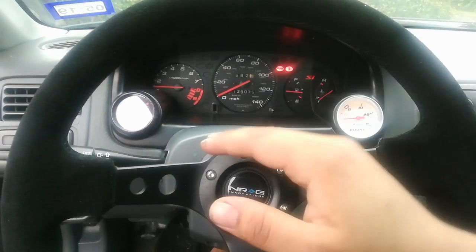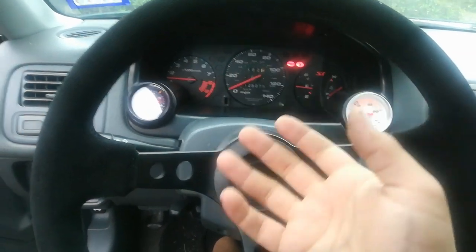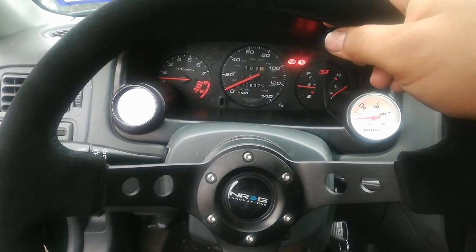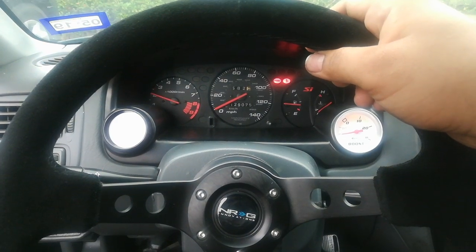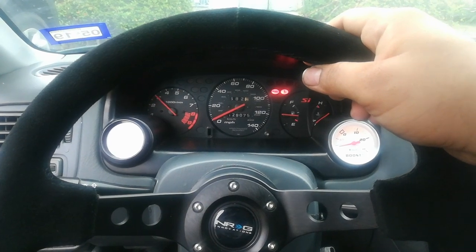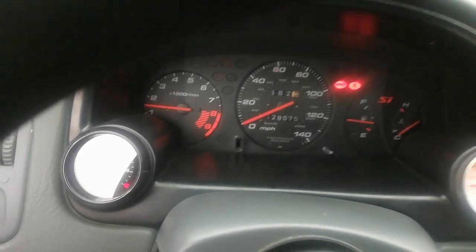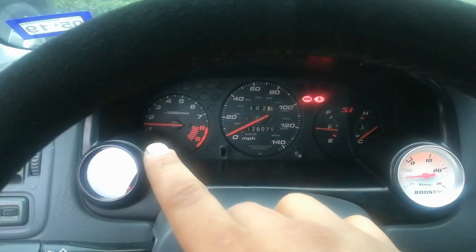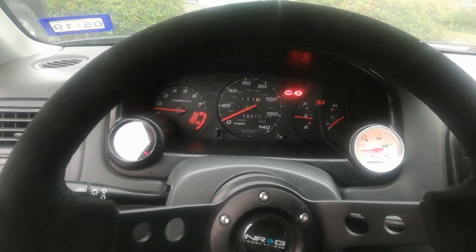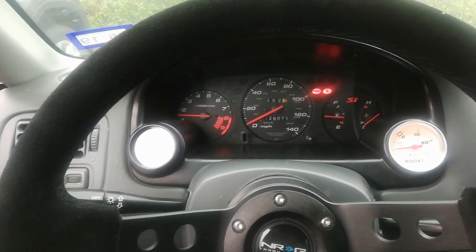A good indication of a vacuum leak is when you rev it up and it's slow to come back down — that's an indication that it's sucking in air. Look, check it out. It's a little lazy to come back down, and that's as low as I could get it at 1500 RPM. No matter what I do, that's as low as it gets. So I'm gonna go ahead and throw on the 70 millimeter and come back to see if it's fixed.